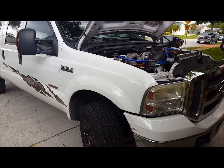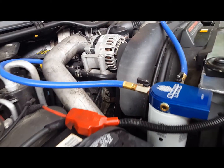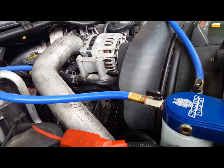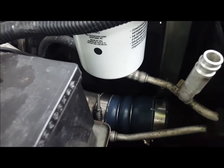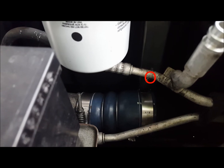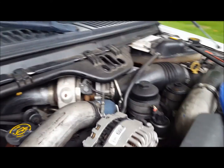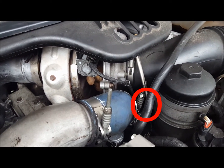So I thought I'd give you a quick rundown of how this goes. Step one is to remove the intercooler charge air tube. You really just have to take that one hose clamp on the right off and let that sit on the intercooler, and then take the farthest one loose where it goes into the turbo.